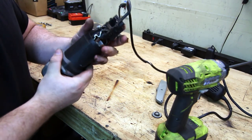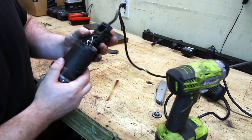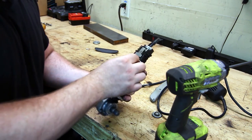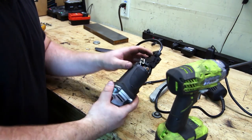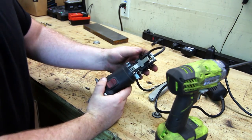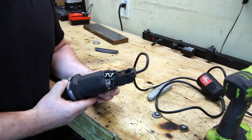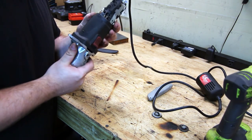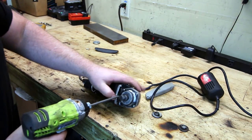This is the switch mechanism — it sits back here and basically pushes down via a little pin. When you push it forward, it just pulls down. The downside is you've got this kind of flimsy piece that can slip off. But the momentary switch itself back here feels actually pretty good. The way it works is it only works when compressed so it automatically shoots back out to make it safe. That's the rear of the motor — there are our brushes.